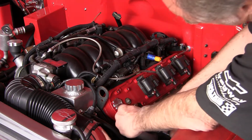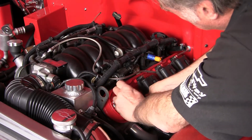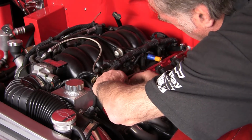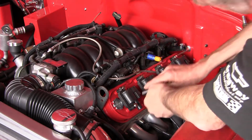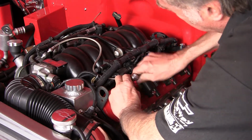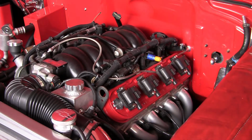Here's the last of the coil packs to go on. They give you this spacer and new bolts at least to put underneath them, clear the base, and just slip the bolt underneath that, and your spacer underneath that, and basically that's it. It's the last of the coil packs, and yeah, that's the problem. You've got to loosen this one all the time when you're going to put oil in the motor. But it's only 2 bolts, I guess, and that's it. Coil packs are on.